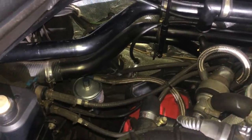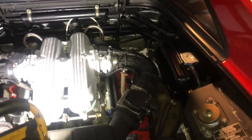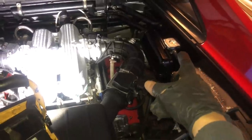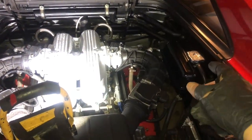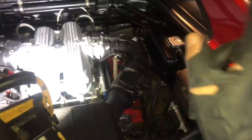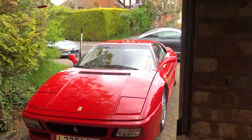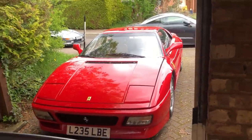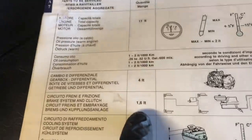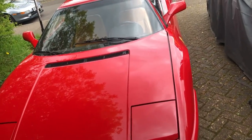That's all the major parts for the annual service. Now we do checks around the car: coolant level has been checked and the coolant was changed a couple of weeks ago when we did the radiators, so that's all good. Next is the brake fluid — I've moved the car outside for access to all four corners. We need 1.6 litres of DOT 4 brake fluid, using a pressurized kit so I can do it solo. I like to use the Brembo DOT 4 — I find it's quite good.